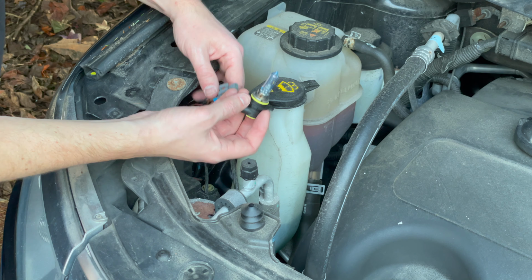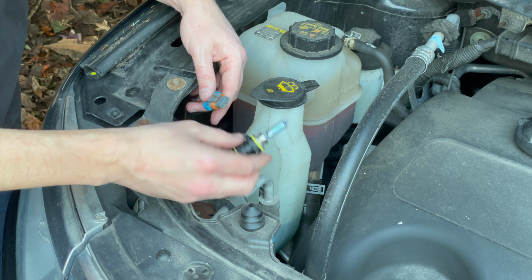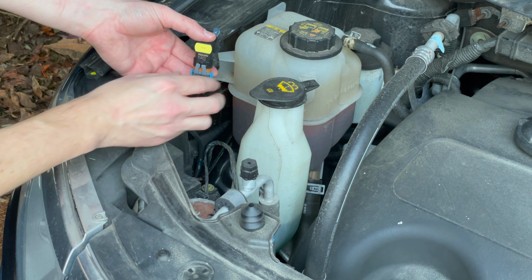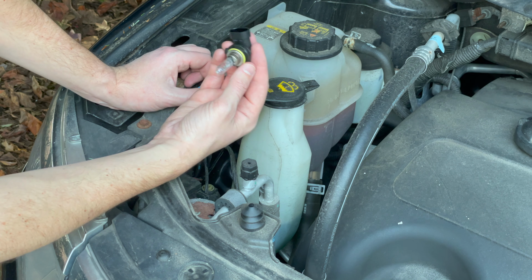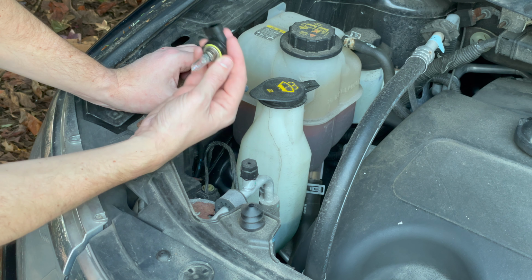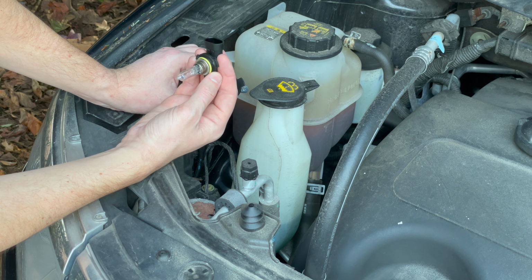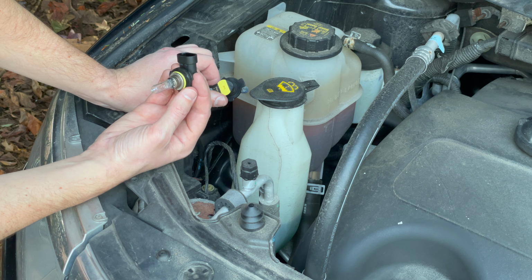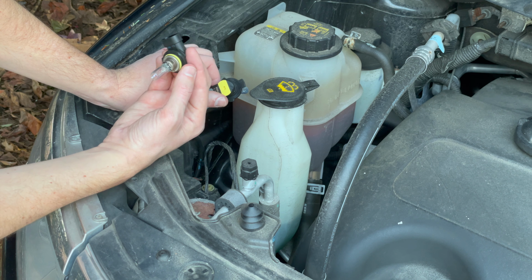Okay, so new bulb. Again, don't touch that glass at all with your finger, or touch it on any of the dirty parts in this engine bay. Bulb goes away from the clip. Snap that into place. When we stuck our hand in there before, we could feel that the housing was like this, which means that when we pull it out, the housing is going to be somewhere like straight up or a little bit to the right when you go to feed it in, because you're going to need that extra little bit to twist it to that lock position, and that lock position was like this.